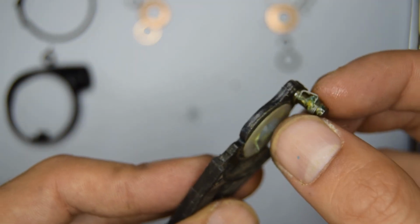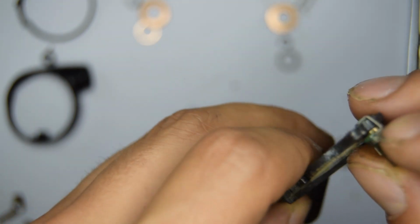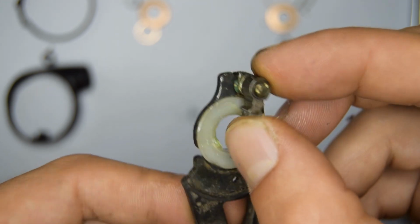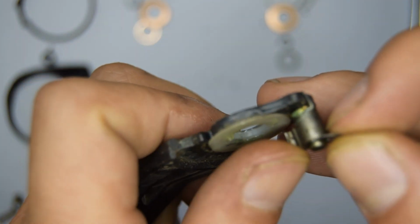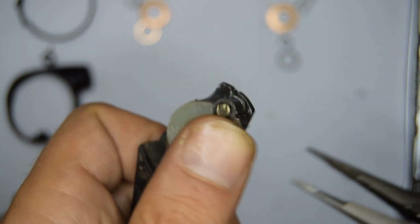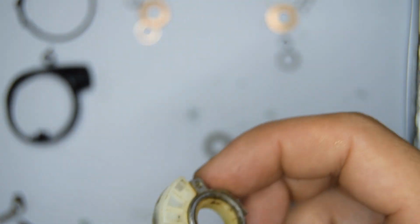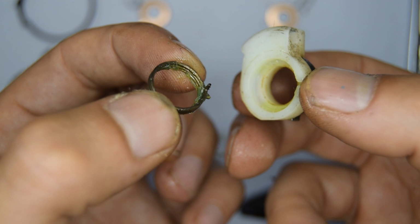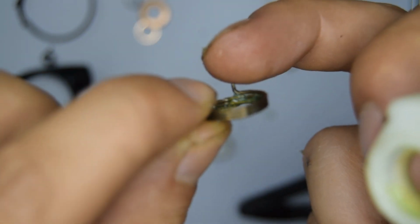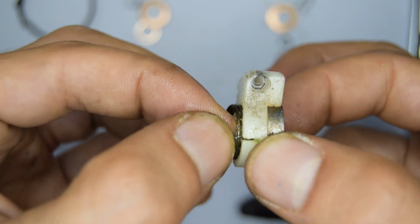First thing we're going to do is put back the spring here and the pull for the lever. Okay, so grab the cam and the sprocket. You'll put the number 5 on the right side. Underneath you'll have the spring. There's one with the tip sticking out. That's going to go right there into that slot. And the tip that's going downwards is going to go in the hole at the back of the body, which we'll install shortly. So let's put that on here.